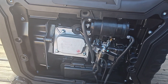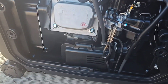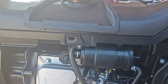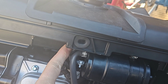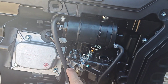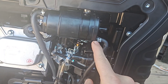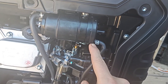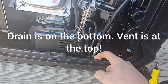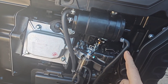This is the access panel for the side with the charcoal canister — this is one of the things you don't have to mod, you don't have to delete it. Another thing is the air filter box; it is slotted so you don't have to drill holes in it for more airflow. This new canister has a line coming from the fuel tank going in at the center, and a vent that goes down to the air box. There's an air inlet and a separate drain, so instead of draining fuel into your air box like previous models, this drips separately. You do not have to mod this — you can keep it.